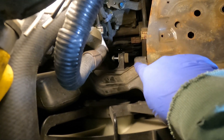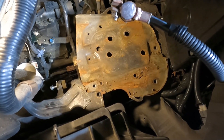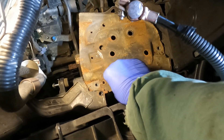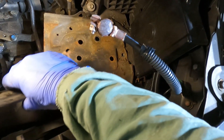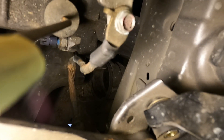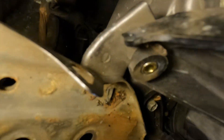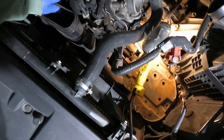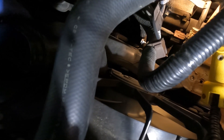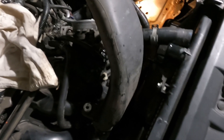This is a 10-millimeter bolt down here — I went ahead and removed it and that did come free. However, the battery tray is still held in place. With that out of the way, your intake duct is right here. I just pulled from the top with some force and pulled it straight out like that. So all you really need to do is remove this one bolt here and you can get it out of the way.